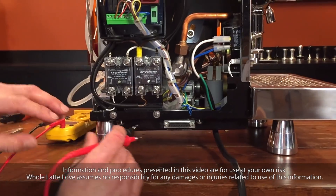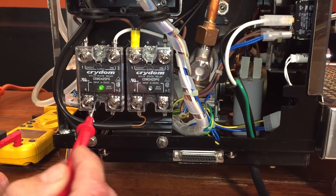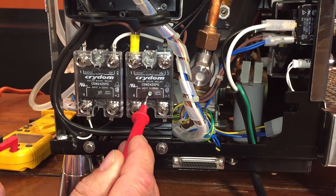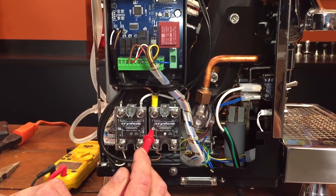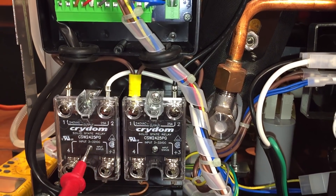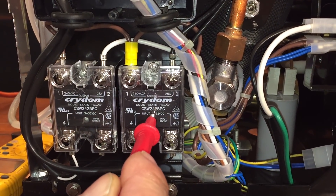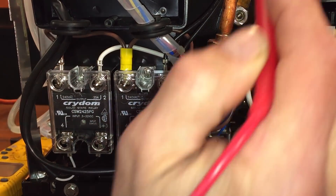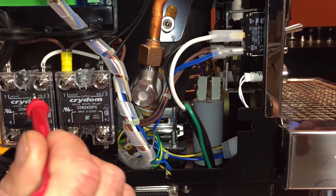You've got to take the housing off, and I'm going to show you some basic parts and then we'll show you how they work. Over here we have static relays. These send the power to the heating elements whenever these little green lights are on — sometimes they'll flash, sometimes they'll be on solid. We have one there and one there. The power that feeds the static relays comes in on this brown wire here, one to each side. When this static relay is calling for heat, it sends power out this white wire over to the steam boiler. When this static relay is calling for heat, it sends power out of this black wire over towards the brew boiler. But what it does is it sends it up to the high limit, which is up here. Then the power goes from the high limit down underneath to the heating element, and the same on the other side with the steam boiler.